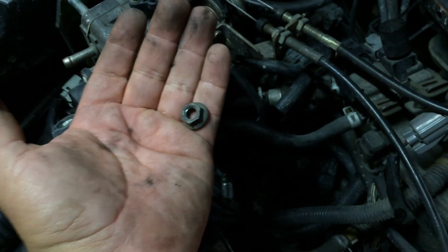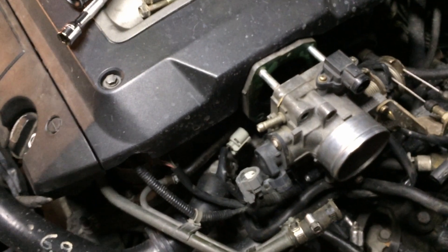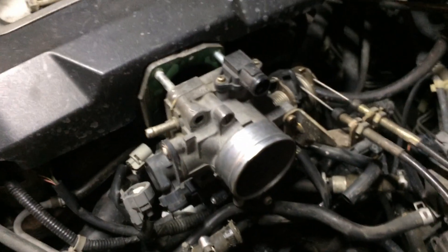We got the two bolts and the two nuts out. Here are the two bolts that reside on the bottom — same length — and just 12mm nuts. Got that separated. There's a gasket right here; typically you don't need to replace that, but if it's gone, missing, cracked, or ripped, go ahead and replace it. Make sure you get all the connectors off, and then just pull it straight up and out.